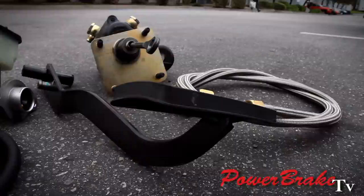It might be a little pricey, but the Hydroboost itself provides great power for that vehicle. We can do just the booster, or we can do the booster with larger wheel cylinders for the back to even out the distribution of power. We can also do the whole mix. If we did just the Hydroboost, we'd use a smaller master cylinder, and without the brake pedal the booster would be centered on the mounting plate. With the Hydroboost and larger wheel cylinders in the rear, we can balance out the distribution of your braking power.